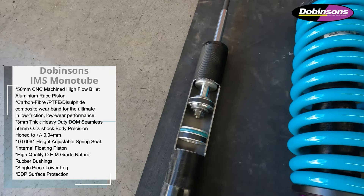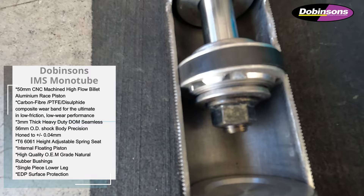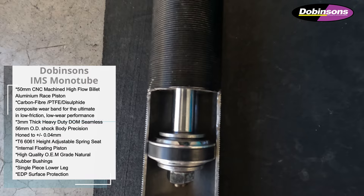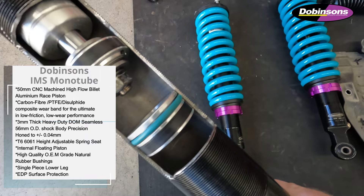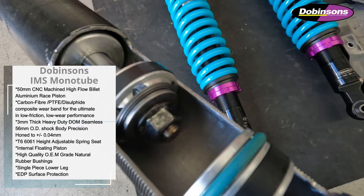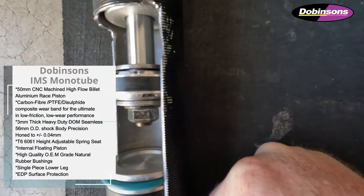Just a bit about the design on these ones — they're a mono tube shock. What that means is on your standard style shock you've got two tubes, so it's a twin tube, and the piston is quite small and the oil and the air are together in the same space. So they can mix, it does cavitate, and it can fade a bit more. This option here separates the air and the oil, and you've got a much bigger piston which gives you different readings on the shims, and you can change the shims on the piston for much more control over where you set it.